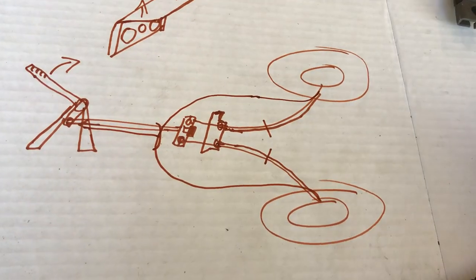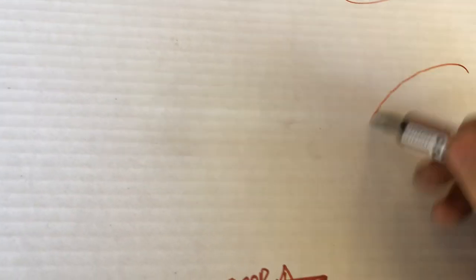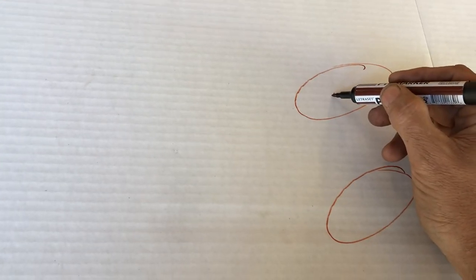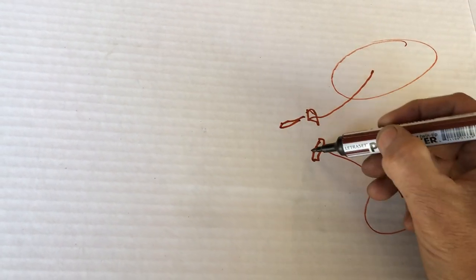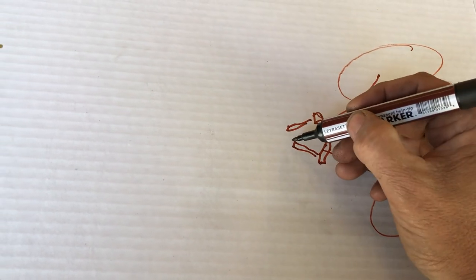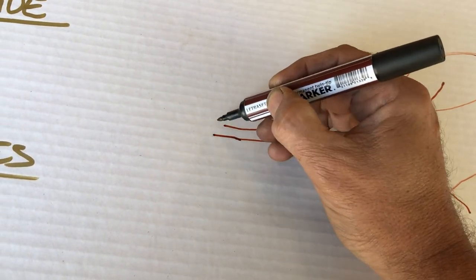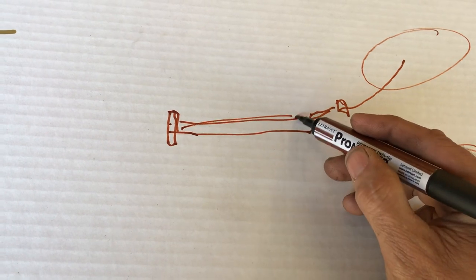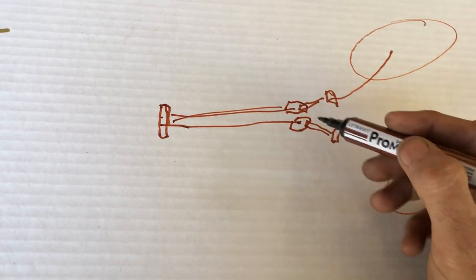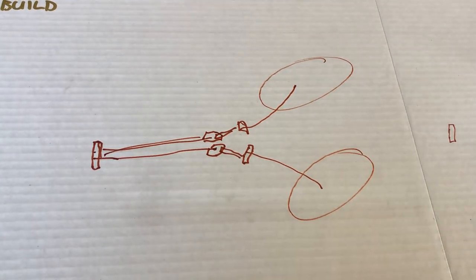So, plan 15C/D. Let's see, let's find some new wheel. Cable is going to come to there. Bracket mounted to the floor. And then the cable protrudes that far. And I will make a joining rod to go from there up to my equalizer, which will still be on the handbrake lever itself. So these will be solid rods with some sort of joining mechanism, joining the steel rod to the ball end. That's the plan so far. Let me see what I can come up with.